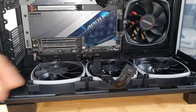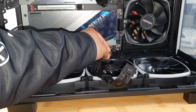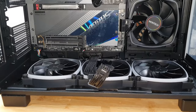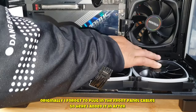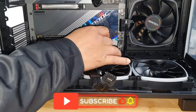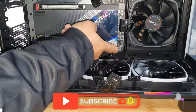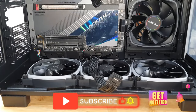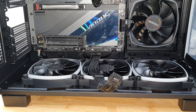Lastly, you've got your front panel cable, which is an all-in-one cable. From what I can see, all you have here is power LED and power switch — there isn't a reset switch at all, and that's fine. They've made it an all-in-one cable. All you have to do is line it up with the far left first nine pins and it will plug straight in. That takes care of your front panel cables in one go — cases doing this now make it so much easier.